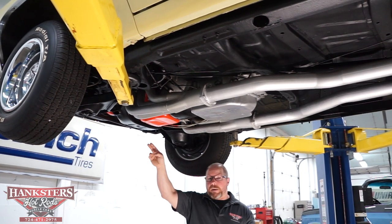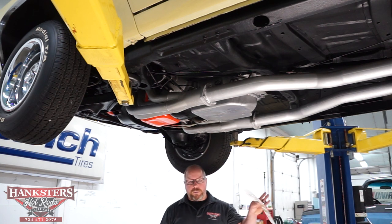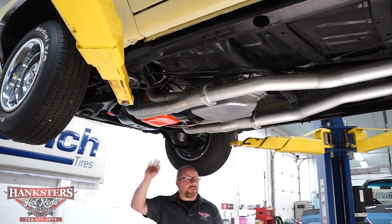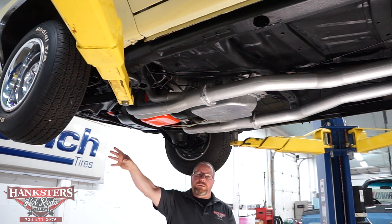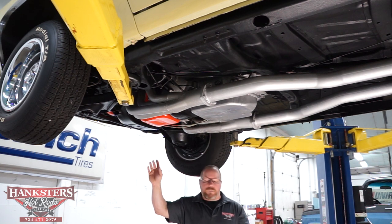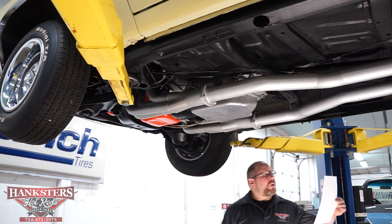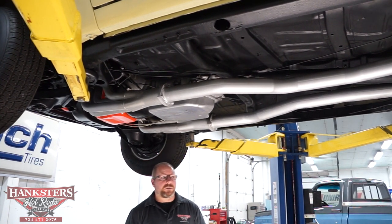As far as the braking system, it's power brakes — disc brakes up front and drum brakes on the rear. It does have all the cables run and a functional parking brake fully hooked up. Out at the ends, it's got all the factory steel rally wheels with beauty rings and center caps, all in great condition. BF Goodrich Radial TA tires all around: 215/70 R15s up front and 235/70 R15s on the back — tread in very good condition.